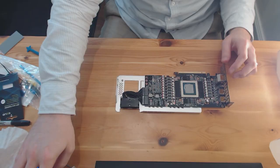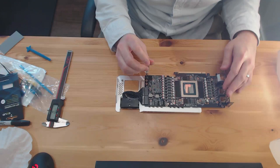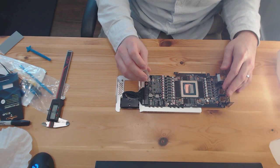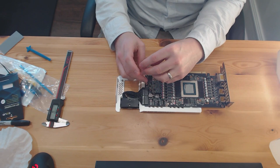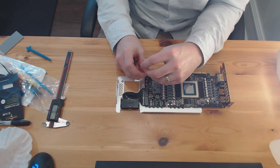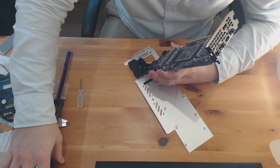There are actually three more screws on the PCB that need to be removed to get the back plate off — one here, one right there, and one right there. And I'll need to disconnect these two power wires. I want to get the back plate off because there are no thermal pads back there from the factory, and adding them should help dissipate heat from the memory through the back plate.